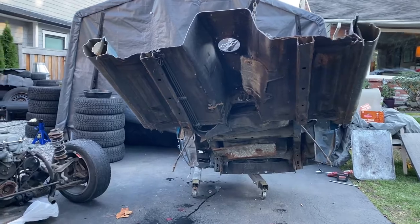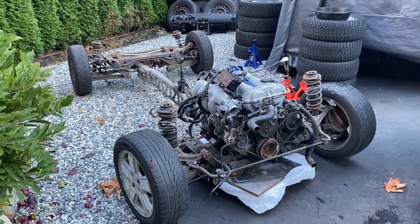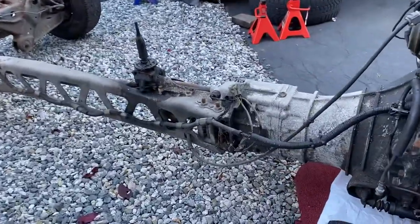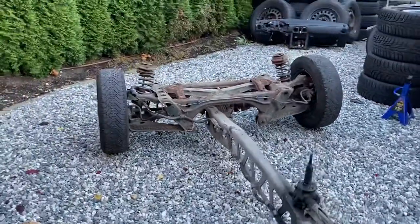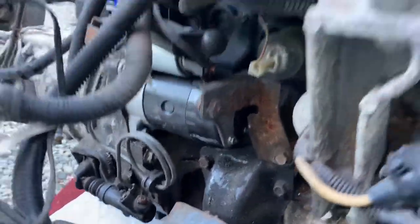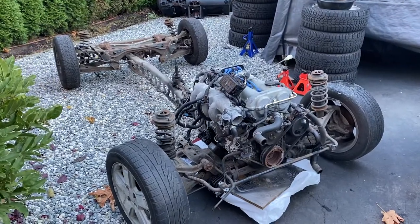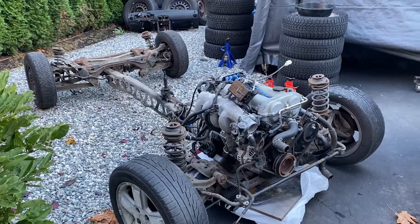That there is what the thing looks like underneath — so that's the rolling chassis. You've got the power plant frame in the middle, you've got the gearbox or the transmission right there, you've got the motor here, and rear subframe and front subframe. There's your starter in there — it's a whole lot easier to get that off when the thing's out of the car like this. You can get the whole body off of it and still leave the bottom part in one piece, just like that.